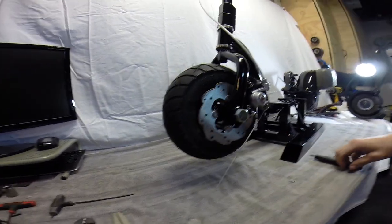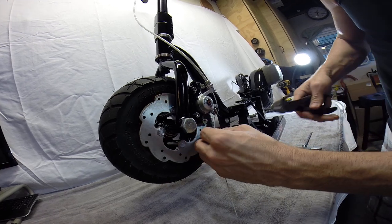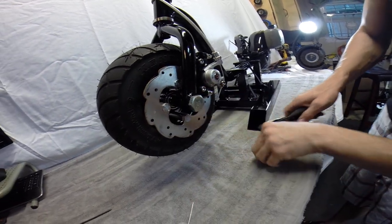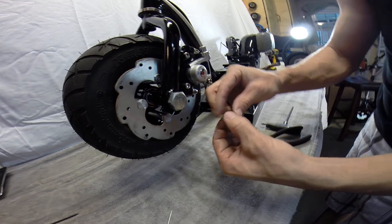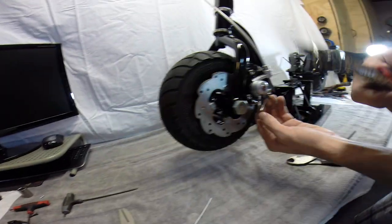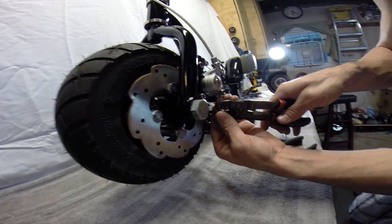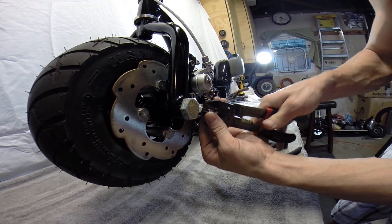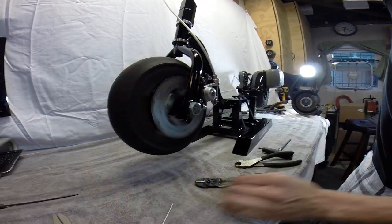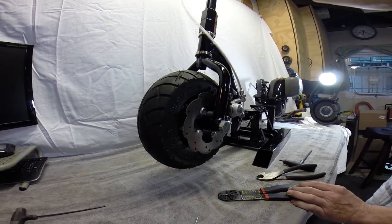So now last, what we're going to do is use our cutters. This extra cable right here — you don't want this much brake cable just hanging here. So I'm going to come up here and cut it. After we cut it, we've got this little end cap — basically it covers the cable so it doesn't unravel and doesn't poke you. We'll use our little crimps and go ahead and crimp it on there, so now it won't come off and it protects you. Brakes are working good, wheel will spin freely with just a little bit of grab — that's perfect, exactly what you want.